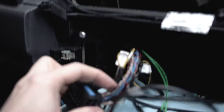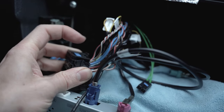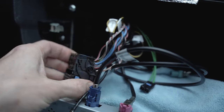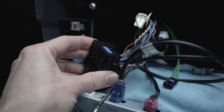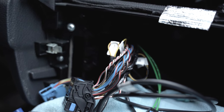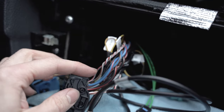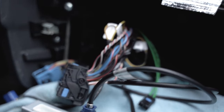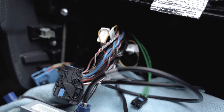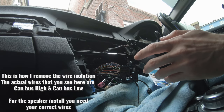The two wires that I'm talking about will be the ones going to the rear speakers. We have the options of the gray and brown, gray and red, or white and brown, white and red. Based on the way that our coupler is sitting when connected to the radio unit, I will be going for the gray ones. Using a proper lighter — one of those with a windproof, very precise flame pattern — I'm going to heat up the isolation, rip it, put the wires in, wrap the wire in between the other small little wires, and solder it, then fix it with some zip ties.